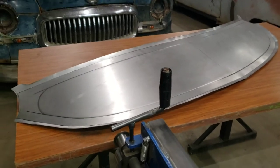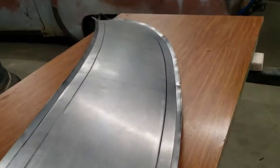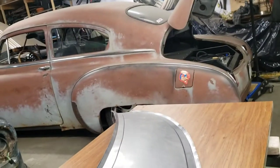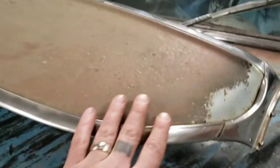It's put a pretty good kink in it and it's starting to look like a visor, but it's actually upside down. It's doing this curve here, so I've got to shrink this all the way around. I've got the shrinker/stretcher — I'm going to go around and shrink both sides. It should flatten it out, and if I go more with it, it'll go the other way. I just want to flatten it for now and figure out angles and bends after.